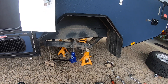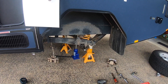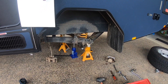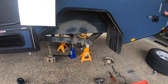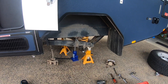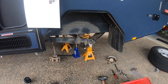I did have a comment on Facebook about crimping brake line hoses. There is some truth to the concern, but like everything — if you know what you're doing and have the relevant experience, it's probably reasonably safe. If you don't, you'll do damage. I certainly wouldn't do it to a braided line, though I have done it on one as a matter of necessity out in the bush. It's no good for the braided line — it destroys the braid, not the rubber inside, but the braid. I replaced the brake lines after that. These rubber lines are just like radiator hoses — if you crush them you'll do damage, but if you're deft with your touch you'll be fine.